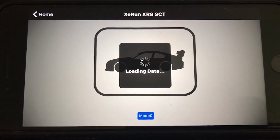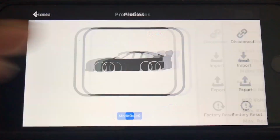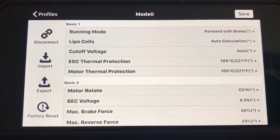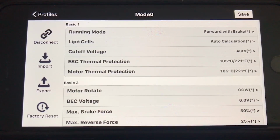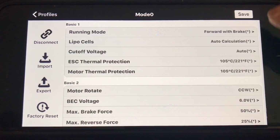If you have the new ones, like I think it's one of the 1/10 scale versions, the Pro Edition, it's like some ESC 3.1 Pro, and that one has about, I think, 5 in total of preset setups. So what you want to do now is just click on the picture, or you click on mode 0, either one. At least for mine, I'm going to be setting it up real basic, just so I can get it in race ready mode. So when I get to the track, I can get everything fully functioning and ready to just practice and then test and tune from there.